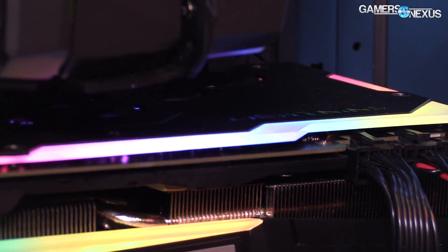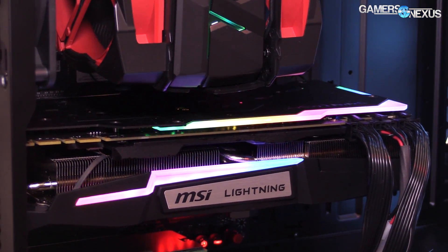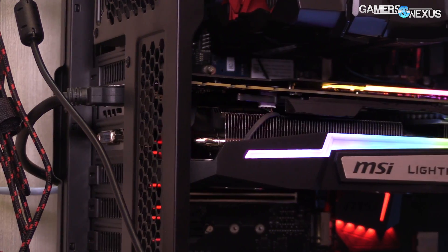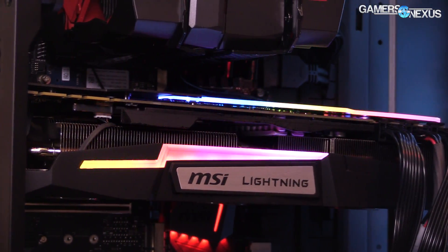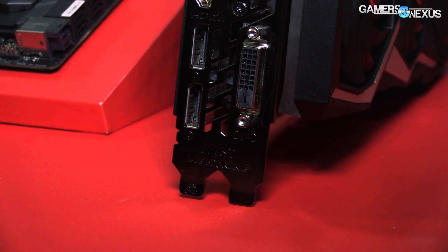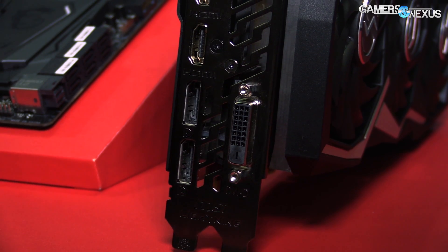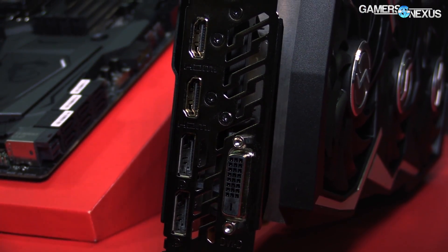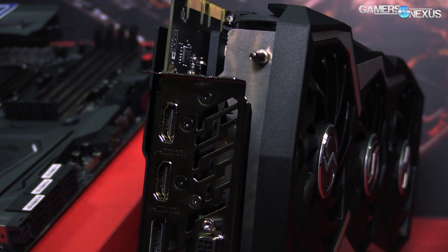So again, that's a 14 plus 3 setup. Last thing of note: there are two BIOS switches — a toggle for two different BIOS modes. One of them is an LN2 BIOS and one is the normal BIOS. The LN2 BIOS is custom and does not have the same voltage limitations as the main BIOS. So if you're doing LN2 overclocking or using exotic cooling, it would help with that and also give you some redundancy in case you make a mistake.